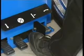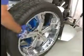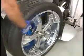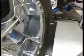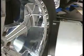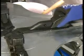Release the breaker foot pedal as soon as the tire bead moves out of the wheel's bead seat. It may be necessary to rotate the tire and repeat the above procedure to dislodge the entire bead. On wheels equipped with low pressure sensors, the bead should be broken at 90 degrees offset from the valve stem. Set the rim clamps to the proper position.